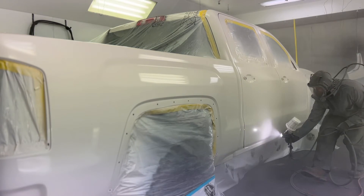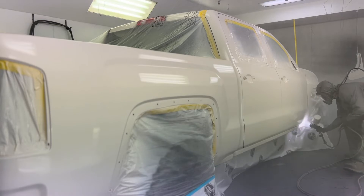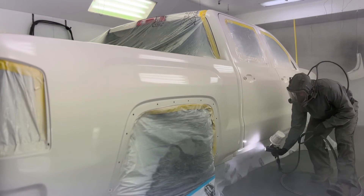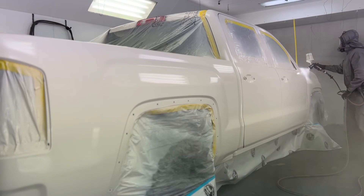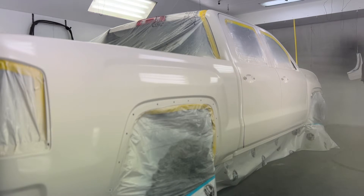Just make it a little bit thicker, which I don't really have an issue with the EnviroBase here. I'd go just a tick lower than what they recommend. But under-reduce, mix a little bit of black in your white sealer and I guarantee you're going to have a lot better coverage. You're going to use a lot less paint to get your end result.